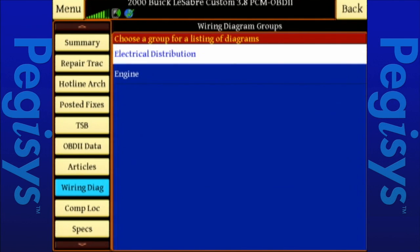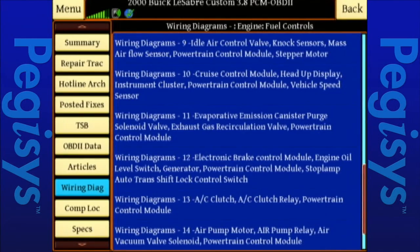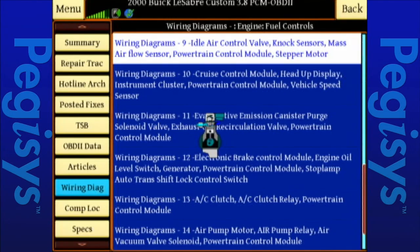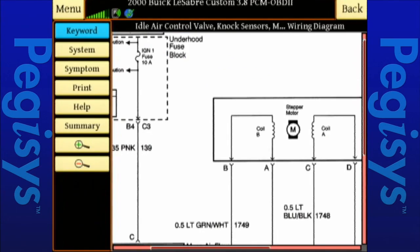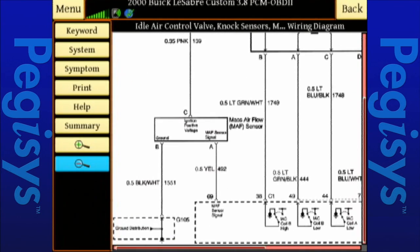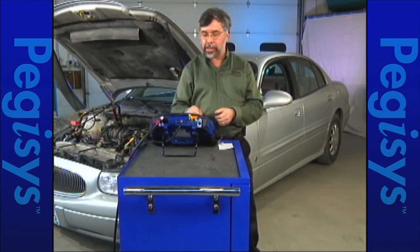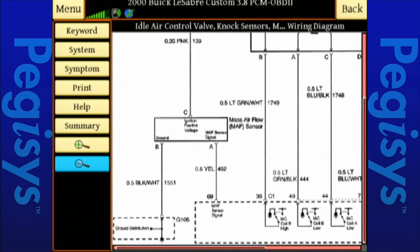I'll tap on the engine and scroll until I find the wiring diagram that has the mass airflow sensor. Number 9 shows the mass airflow sensor is there. Up will come an OE wiring diagram. I'll scroll around until I find the mass airflow sensor. I want to see what my mass airflow sensor signal wire is so I know what to hook my lab scope to. The yellow wire is my signal wire. Where it goes to the control module, it's yellow at pin 69 — pin 69 at the control module and pin A at the mass airflow sensor.